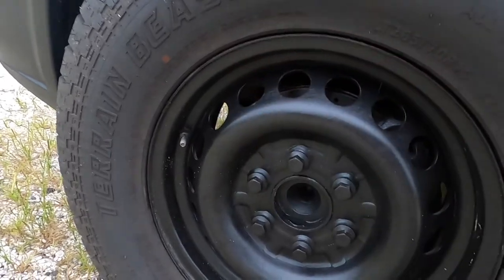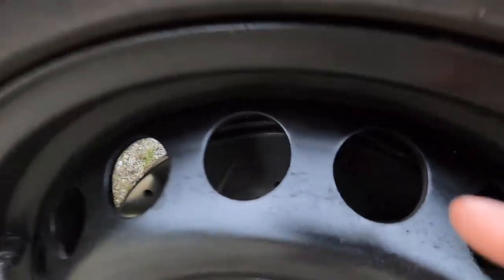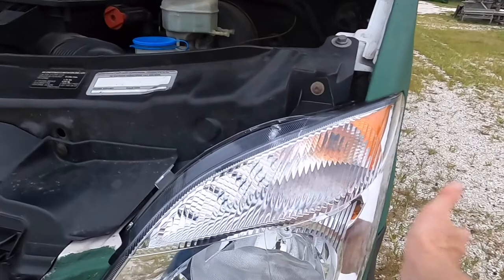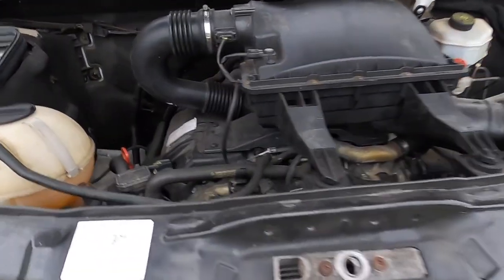All the wheels are rubberized with truck bed paint so you won't worry about scratching them. If you look in there you'll notice drilled and vented rotors — we did new brakes and everything. We also did new Bilstein struts on this van because the stock suspension was absolute crap; it would just rock back and forth over any bump. We have Bilstein struts and shocks front and rear, as well as vented and drilled rotors for the brakes, so you actually have real braking power. We also replaced the headlights.